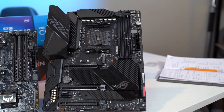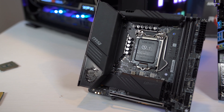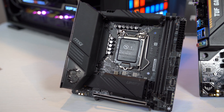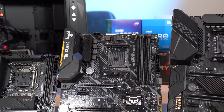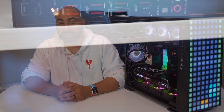Mini-ITX boards can also be quite pricey simply because of the engineering effort required to cram most of that same stuff onto a smaller PCB, but you'll only get two memory slots as opposed to four, meaning RAM capacity is lessened. Again, micro-ATX boards fall somewhere in the middle, but because of the lower popularity, you do have far fewer options. As a positive, micro-ATX boards are typically the cheapest of the three, and because of the flexibility of the smaller size, they can be used in either ATX or micro-ATX cases.